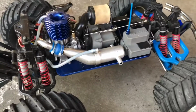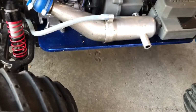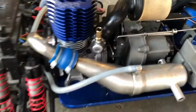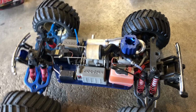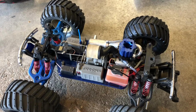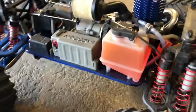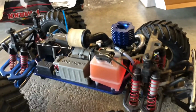All right, now that we have finished the tank of half throttle driving, we're going to once again bring it to bottom dead center to cool. There we go, it's at bottom dead center. Once you have the engine preheated for the next tank, you will be doing 3/4 throttle bursts and then braking. Once again, once we're done, we're going to be running the fuel completely out, just like in the second tank, and putting the piston at bottom dead center.